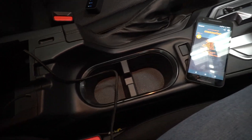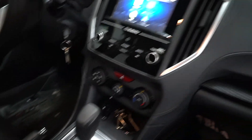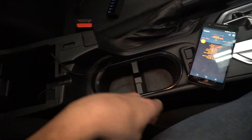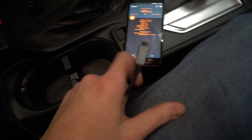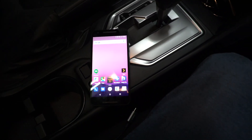Here's a quick demonstration about Android Auto not charging very well. Pretty much with any car that has a USB jack that plugs into the default head unit, none of them charge very quick. In my case, the phone was actually dropping battery power even though it said it was charging, because it wasn't charging fast enough for the amount of energy being used.